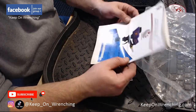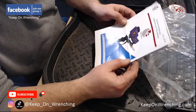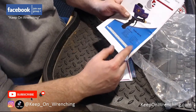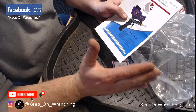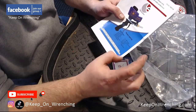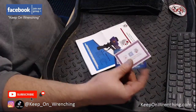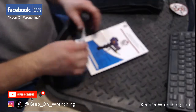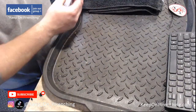And I find that I kind of need at least 70 to 90 PSI to do a lot of the sandblasting I'm needing. Once I fall below like 55 or so, it takes a long time to do stuff. But when I've got good pressure between 70 and up, I do really, really good. So I don't know, I'm optimistic. It's worth a try. I don't want to lose these registration cards. I'm going to definitely register the product in case it goes sideways on me. And we can deal with that. So, I don't know. I think it's cool.